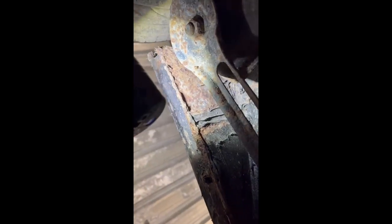It could do with just cleaning up and treating, and actually what's been done there is totally solid and it will last. Same with the axle carrier mount above. As you can see, the inner wheel tub there's all right. The lines have all been covered in who knows what, so how good they are, I wouldn't like to say, but they look okay. The seal, the relief strip all the way along's okay.